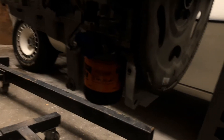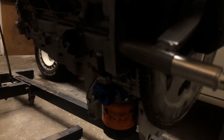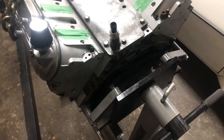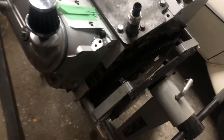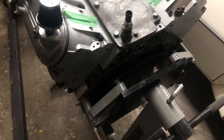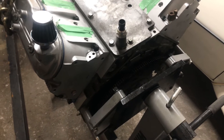There's two little screws that bolt up on the oil pan at the bottom, they're really long screws. I had a little bit of a leak at one point and I was like, where is this oil coming from? I always thought it was from the back seal there. I took the little safety cover off, I looked inside the inspection plate and the transmission, the 4L70, and I really couldn't see anything. Then I was thinking maybe it's leaking from the gasket in the back, the big plate in the back that covers the back of the block. Nope — it was actually leaking from the valve covers in the back, from the rubbers.